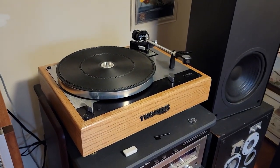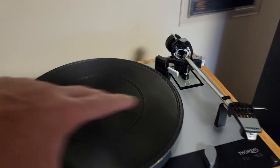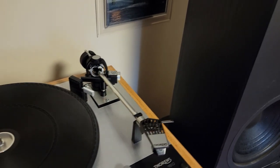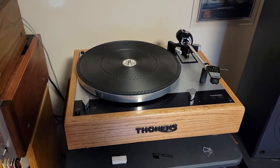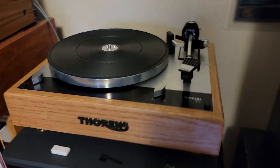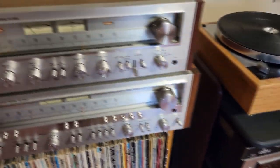My design plan is for this turntable, which I've just completely refurbished. I've got a multi-part video series on retuning and setting one of these things up — I built the plinth, transferred it out of the old crappy plinth, did all the suspension tuning, and changed out the arm. The old arm had a bend where the head shell goes onto the TP-11 arm, so I got a new arm from Switzerland. I also put on a cue-up lever so it will auto-lift at the end of the record, which protects the stylus — a Goldring E3 on this one. It's a lovely-sounding turntable, right next to my big Pioneer SX-950 that I refurbished last summer.